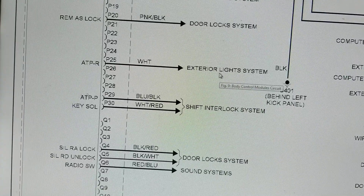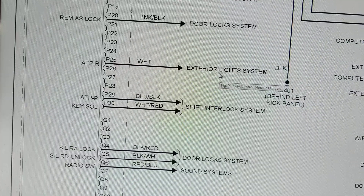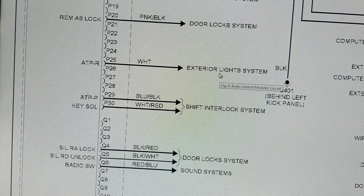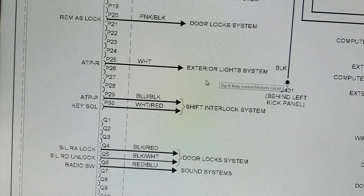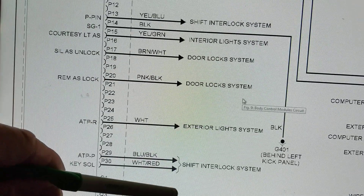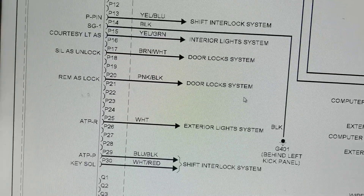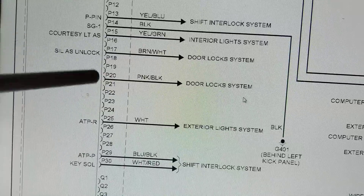I'm not going to the engine performance section. I don't have a problem with the alternator - otherwise the car would have shut off. No problem with the starter motor or the air conditioning. My problems are door locks, exterior lights, and warning lights - all going crazy. I went to work, put the car on, and none of the accessories worked. This module is in charge of your accessories.